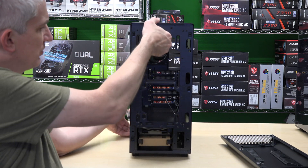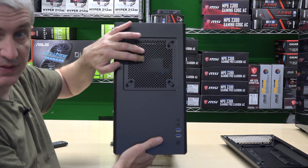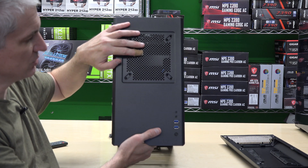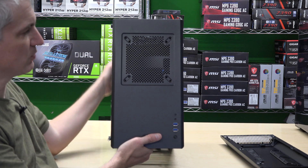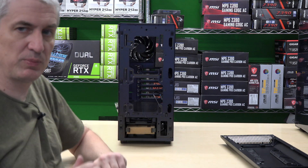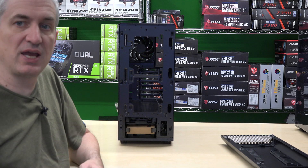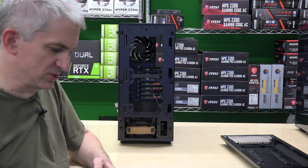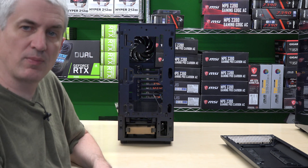The other somewhat restrictive thing was there's only one spot for a fan in the top, as opposed to the case I'm about to show you, which has two. That gives us more flexibility. It doesn't mean we're going to put two fans there — we only put as many fans as are necessary. You don't want to over-ventilate a case because then you wind up with excessive dust. So out with the old, in with the new — let's talk about the new.